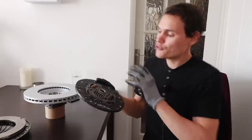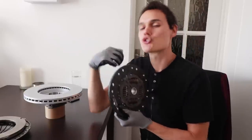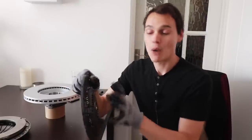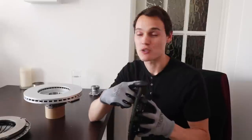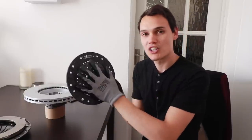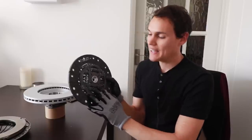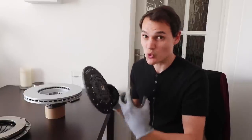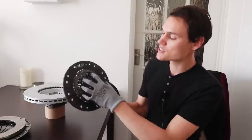If you try to avoid wearing the friction disc by not holding the bite point and moving away too sharply, you're going to start putting shock through your car. Moving in a jerky fashion thinking you're saving your clutch is probably causing more damage. My clutches don't die because of friction material wear — when I'm done with a clutch, the friction material still has about 80% of its life left. What wears is the shock mechanism in the friction disc. If you lift the clutch too harshly, drop the clutch quickly, the car lurches and this mechanism gets put under a lot of pressure.